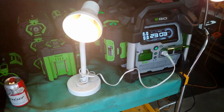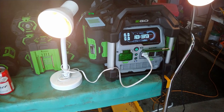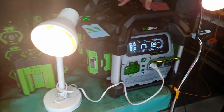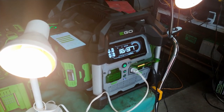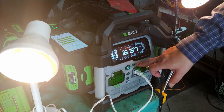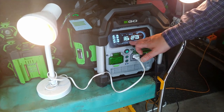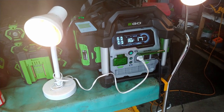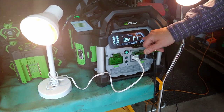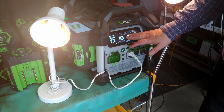Let's briefly touch on what the power of this thing can do — this will be 2,000 watts continuous. Let's say I've got an old-style fridge with a compressor; when it first fires up it draws a lot of power. Well, this will let you peak out at 3,000 watts before it trips. So you've got a sudden impact power of 3,000 watts but it'll continuously run at 2,000. Once that capacitor is full, it zaps the compressor, and once it's running it drops back down to a lower rate — usually a third of startup power — and this thing will handle it.